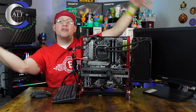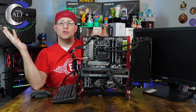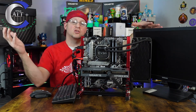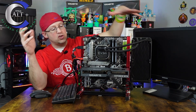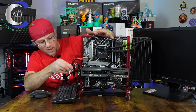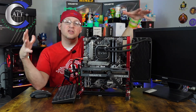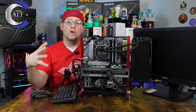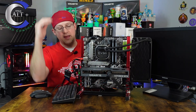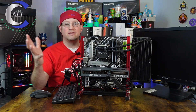We're back — we've got it plugged into the test bench and we're all set up. The only thing to do is power this thing on and make sure we get a boot and then an image. Let's plug into the GPU first to confirm display out. Once we confirm the GPU is giving display output, we'll run the specific GPU test, stress test it, and check the memory to make sure everything is functioning as it should.